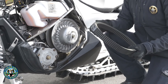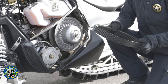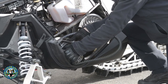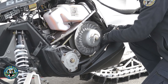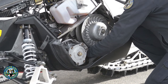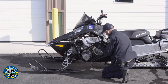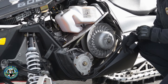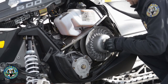These belts are getting pricey — about 180 to 200 bucks nowadays. But if you run with a damaged belt it's going to mess up your clutches, so again, taking care of this wearable part saves the more expensive parts. To reinstall, put it back on so you can read the writing on it facing out toward you. Roll it onto the primary, then stick it on the secondary. As you loosen the key tool, keep working the belt back up — if you just screw it out without working the belt up, the belt would sit all the way down and when you hit the gas the clutch would slap down on it, scarring the belt and creating a potential failure point.